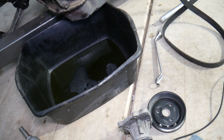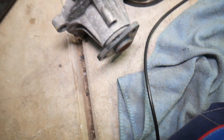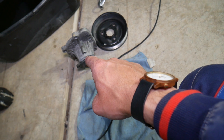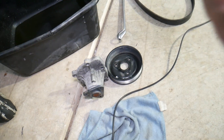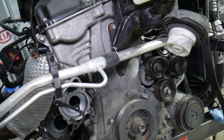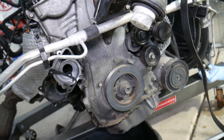Those are the two main places that can develop leaks. We recommend wiping the area clean and identifying where the leak is coming from. If it's from the front of the pump, the pump needs to be replaced. If it's from the gasket, you might replace just the gasket — but if you're already in there, put a new pump too, since it's not very expensive. We'll put the link in the description below. Hopefully this video is helpful — thank you for watching, see you next time.